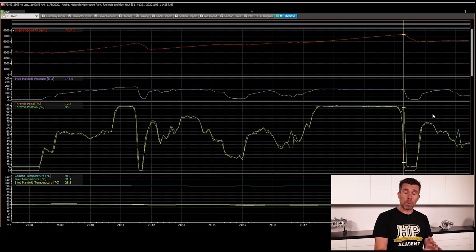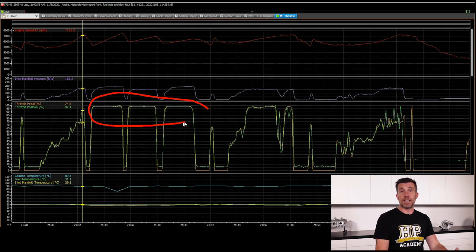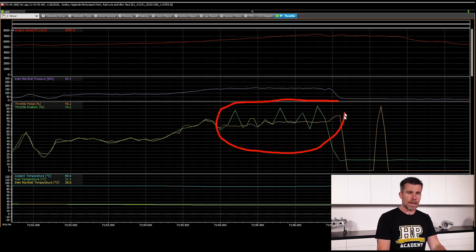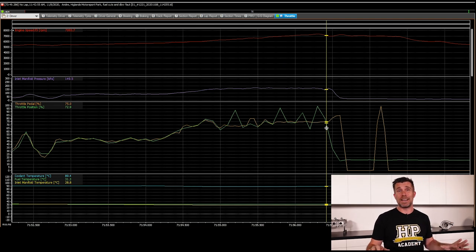If we fast forward a little bit, here's some data where things do tend to go more pear-shaped. This is towards the end of one of my sessions where the ECU went into fault. At this particular position I'm only at around 75% throttle and we can see the throttle position almost goes wide open. Through a wide-open throttle acceleration area everything actually looks pretty good, but then we start seeing worrying signs — a big blip in the throttle we weren't asking for, then again some error where I'm almost at full throttle. Fast-forwarding further, the driver's foot pedal is reasonably consistent around 70–75%, but we start seeing this erratic oscillation in the measured throttle position. The ECU has said enough — something's not right — and is going to cut the fuel in case something is seriously wrong.